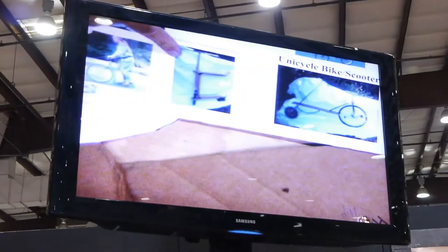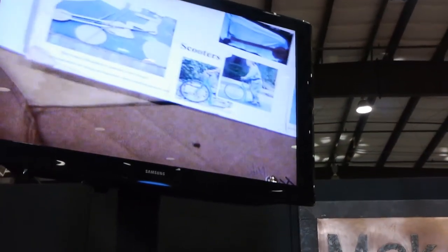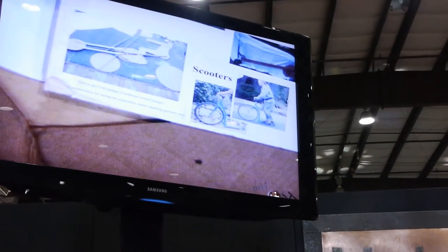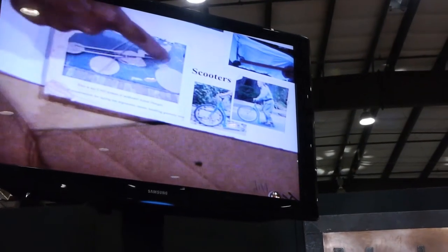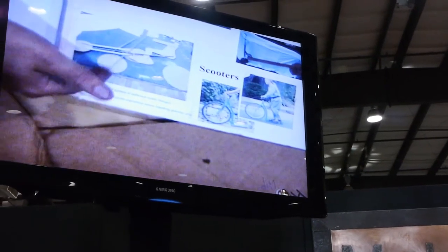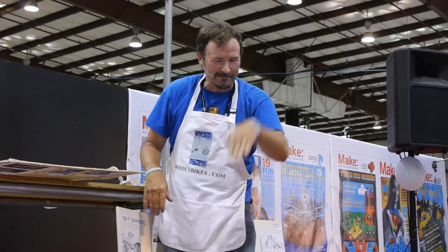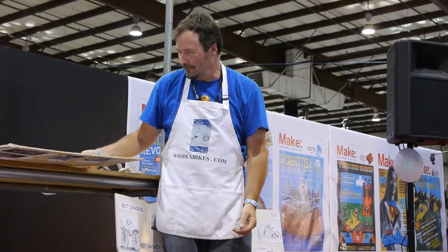Another one is this idea — a chair rail with a Razor scooter steering and a closet pole. Then here you can see the full-size CAD layout. This is where my daughter would sit out front, and this is me with the steering running through the steering axis to the front wheel. It was a pretty complex tandem with a long chain line, and we had to figure out where both of us would sit and get the steering axis behind her so she could be out front.